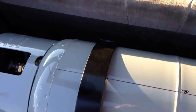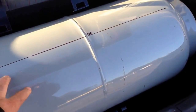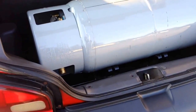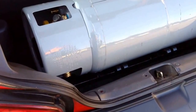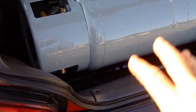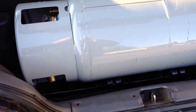I just thought I'd put the camera on here and shoot a quick update because we don't really know how much propane stuff is on here. The new mount is really nice, and the reason we came up with this mount is you can lift the tank out really easily — it just takes probably 60 seconds to take the tank out. A wing nut takes out the mount, and then you can pull the spare tire out, jack, all that stuff, change the tire if you want. Then it all just goes back in — sets down, wing nut back down. Real strong, real stable, sturdy.